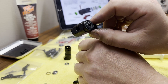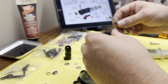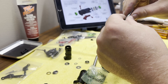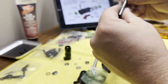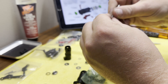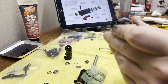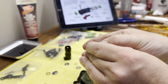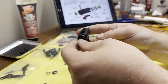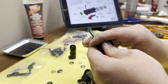Alright, so we have our dampers in the head — I wasn't lying when I said it was messy. Next step is we're going to put a little grease on our feathering shaft. Once it's greased up, slide it through. It's important to clean out the feathering shaft as well because all this grease isn't going to mix well with the Loctite we're going to put on. I usually try to get it remotely even at this step.